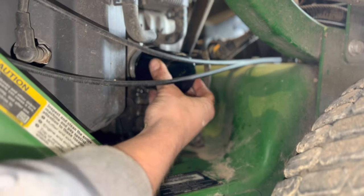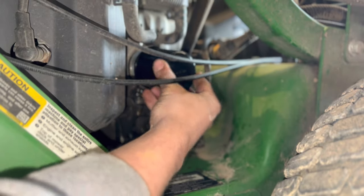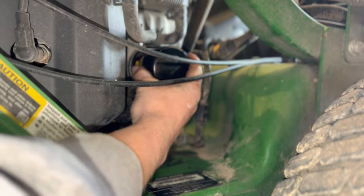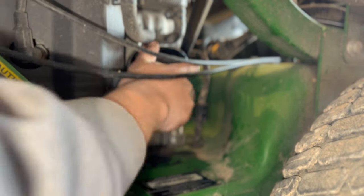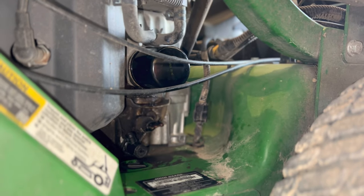Always want to make sure you got good lubrication on these O-rings. Wipe my hand off real quick and let's spin this on. Anytime I'm changing the oil on something, I always turn it in all the way and give it a nice snug half turn — like so. There we go, let's add some oil in now.